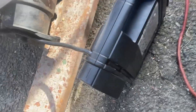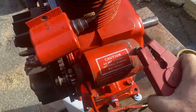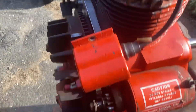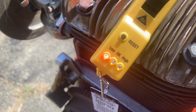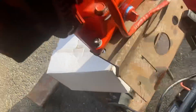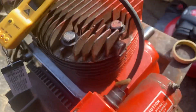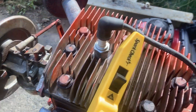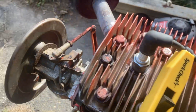No spark. I take this thing — fresh rebuild, it's ready to go. I threw some fuel in there. No spark. I've got my patented spark checker, which I love. See how it's red? If there's spark, it should go green or high yellow. Right now I get nada. Nothing — there's no spark going through. I even pulled the spark plug wire off and put my finger in there, figuring if there's any spark, maybe even a low spark — shock me. Nope. There's nothing coming out.